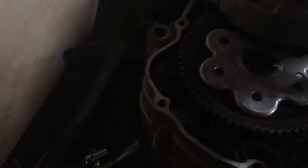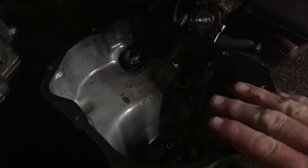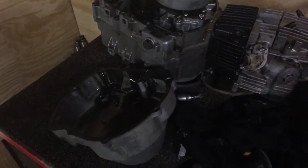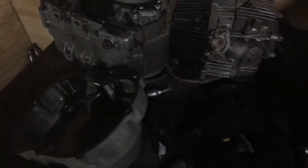It has a little arm that comes in from underneath, and that has a spring on it. I'll see if I can get that in the light for you so you can see it. But for now, I'm just going to clean that up, clean the strainer, reinstall that, new gasket on the cover, and paint the outside of it with the cast iron engine paint, which I've done the rest of it. That's just a bit of a clean-up through here, and that engine's pretty much ready to go in.